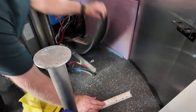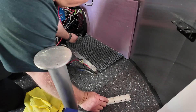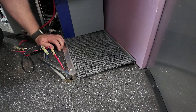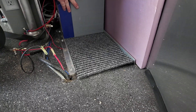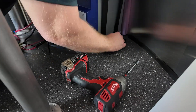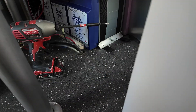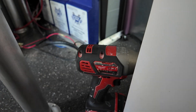A little Hollywood magic — you see that pink insulation that appeared there while you blinked; we'll talk about that in a minute. Right now I'm cutting a piece of carpet to put in there, more as a vibration pad, but it will also add a little insulative value between the cold floor and the batteries. Now we'll put the batteries in and they fit nice and snug — almost had to wedge that in there, and that's what you want. You want it to be a tight fit.